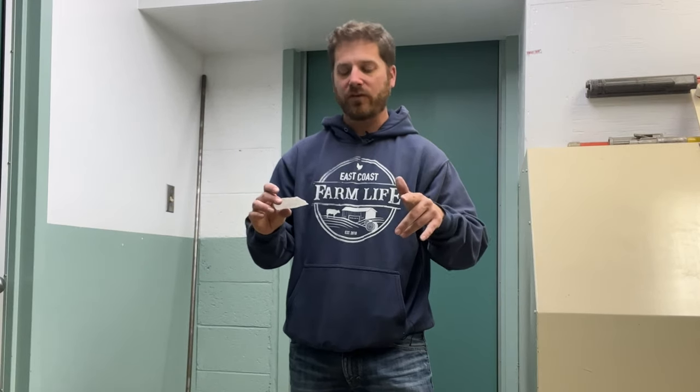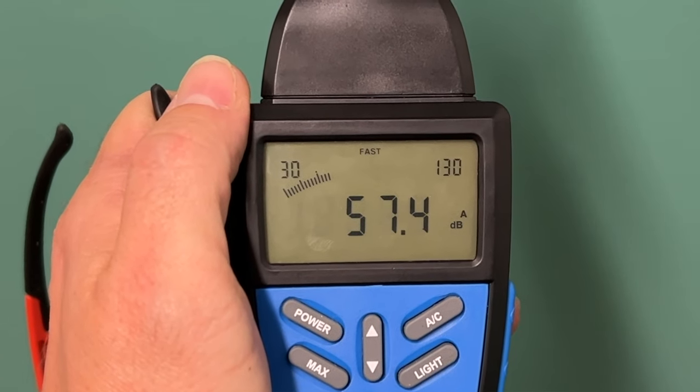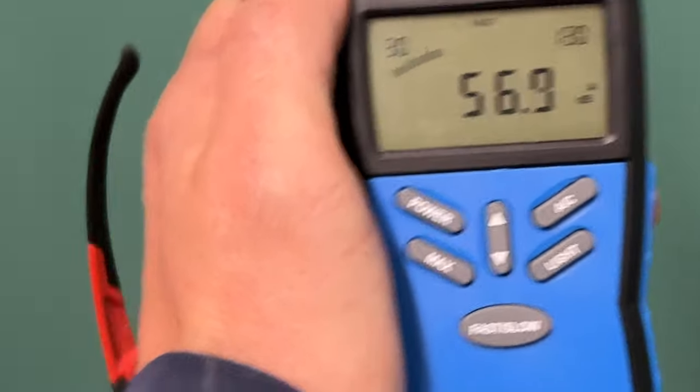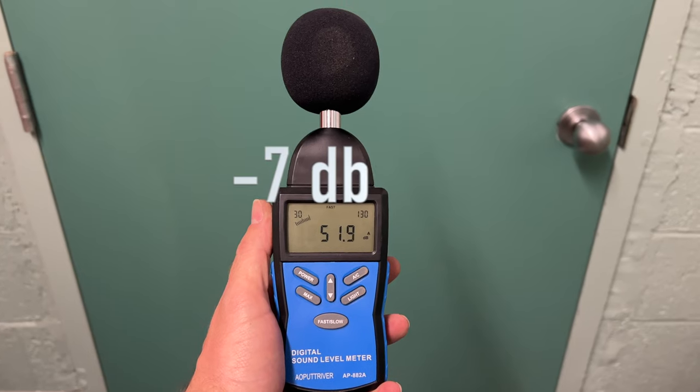So I have the results, which are pretty good, as you just saw on your screen. With just the static radio, white noise, without the door seal kit, you had 57, 58 decibels. After installing the door seal kit, it dropped from 57, 58 to 51, 52. That's pretty good for just adding a door seal kit, which is quite easy to install and very affordable. I'll have links in the description below.